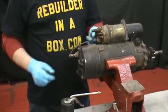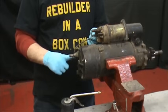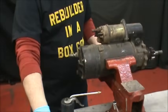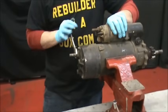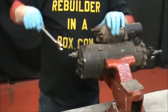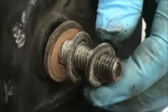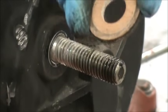Next we're going to remove the ground wire and ground bolt assembly. The wire goes from the ground side of the solenoid down to the ground bolt on the motor and is held on at the solenoid by a 3/8. Take that off and then remove your ground wire. Then you need a 3/4 wrench. Put a couple drops of oil on the threads so that as you back the nut off — which is half 13 — you don't do any damage, because if at all possible you want to try to reuse that stud. Then taking the rest of the hardware off the stud: a lock washer, a steel flat washer, and the fiber insulator.